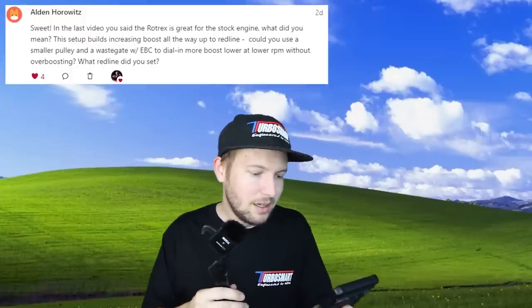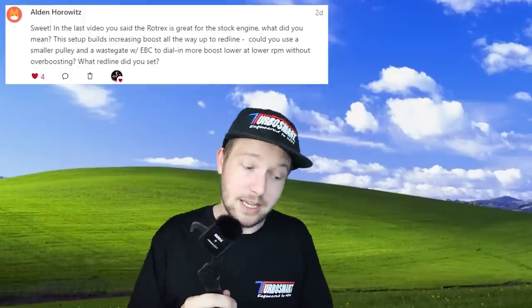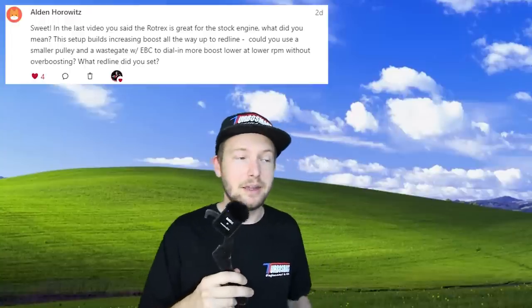Alden asks, in the last video you said Rotrex is great for the stock engine. What did you mean? The setup increasing boost all the way to redline? Yeah, that's actually exactly what I mean, in that Rotrex makes torque in the high RPM and it doesn't overload the engine with low RPM torque. So if you want to make a lot of horsepower safely, Rotrex is a great way to do it because it's only going to make power up in the high RPM where it's a lot easier on the stock rods, the stock transmission, and the stock differential.